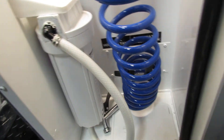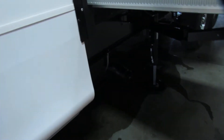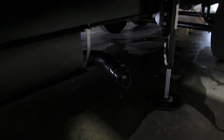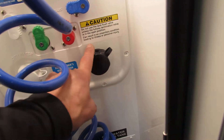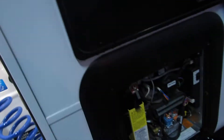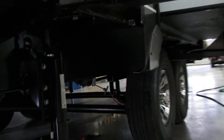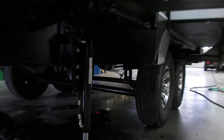The gray and black dump is right here, and that goes to that. Just hook your hose up, and then this system — you have the black tank flush. City water. Everything connects to that one. Black tank flush is only to clean the black tank. Make sure your valve is open, your caps off, and your hose hooked up. Way over there is the handle for the kitchen sink drain — that's right there, up in front of the tire. I'll push that in for you.